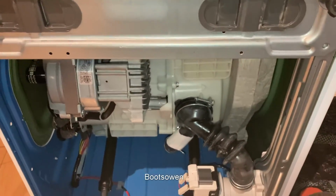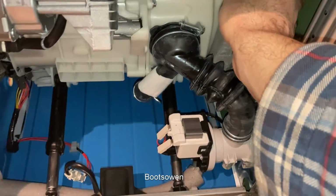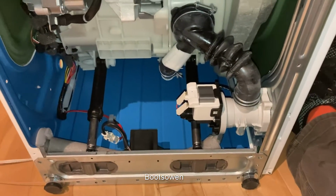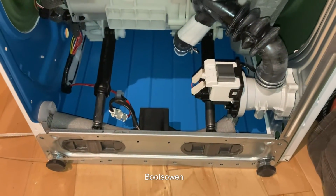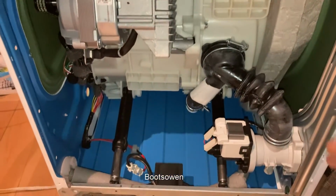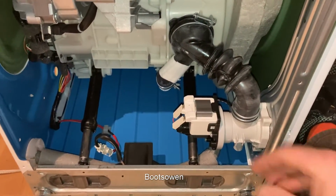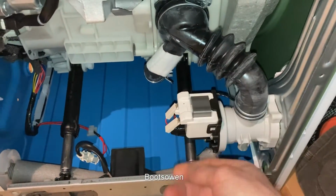Right, I just have to put the covers on the back and install it, so I guess kind of that's it for now. Lower concrete ballast, top concrete ballast. It's a standard machine, 4 shock absorbers, which is more than other ones. I guess that's maybe to do with 8 kilos. It looks to me to be an eminently serviceable machine if you can get parts for it, and that's probably the tricky bit. Bearings, you see though, if the bearings wear out, you could do them, which would be good.